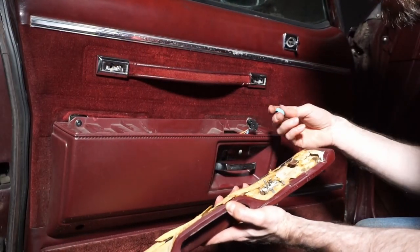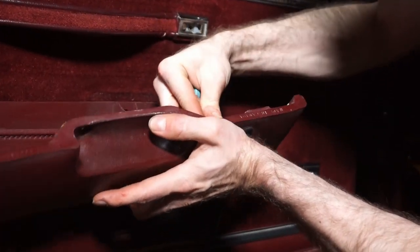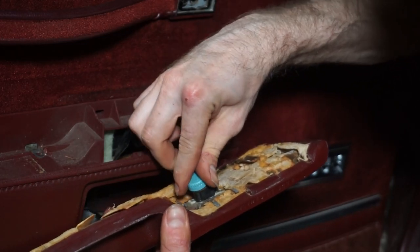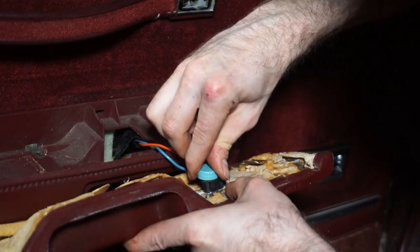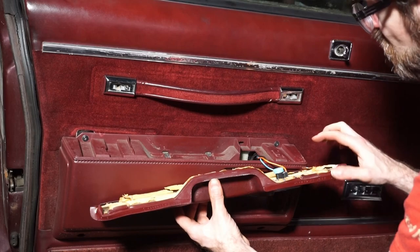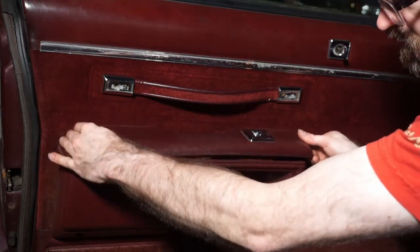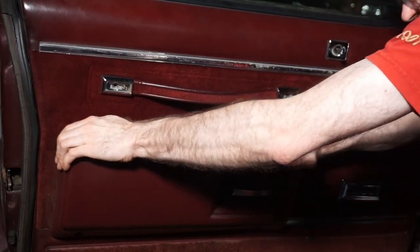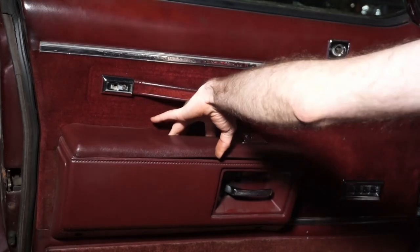Okay, so if you remember, the tall pin is terminal A on this guy, so he just goes like this. So we've got our lock actuator connector on here. And then you just kind of spin these, hold it down on top, yep, like so, and that kind of just locks it in place. All right, so remember, you have one and you have two, and they slot into here and here. So what you do, you kind of get her in here, oops, all right, and then you kind of slide back like that. And now it's in there.